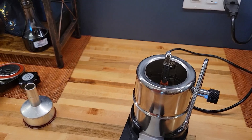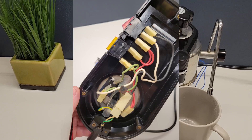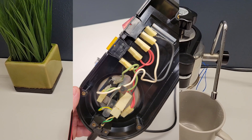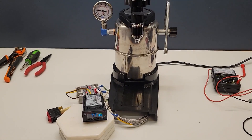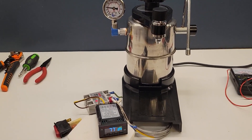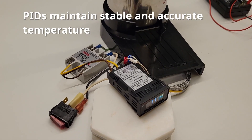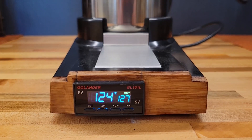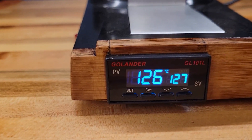This is something not to be underestimated. The main goal of this project was improving the thermal management. These old units use thermostats which can give you a deviation of more than 20 degrees centigrade. Steam pressure, however, is non-linear and increases rapidly with temperature, so even a small drop in temperature can result in significant loss of pressure. I decided to install a PID with a solid state relay. The PID control made all the difference — it keeps the temperature stable, reacts quickly to temperature changes, and the machine is able to maintain strong steam power.